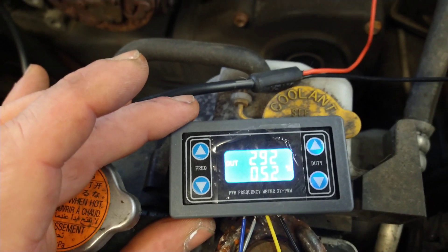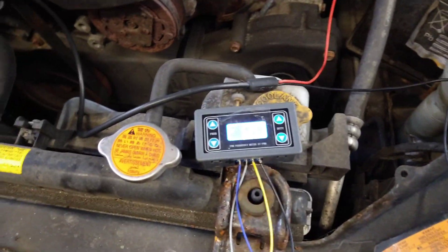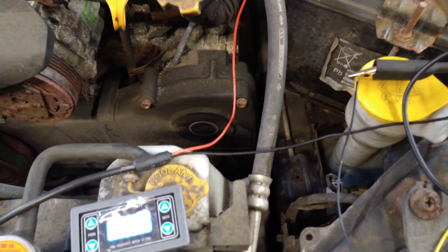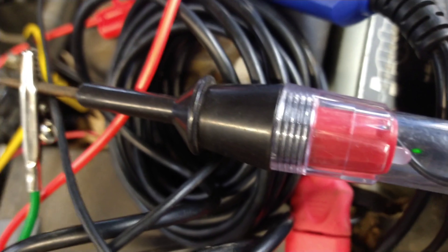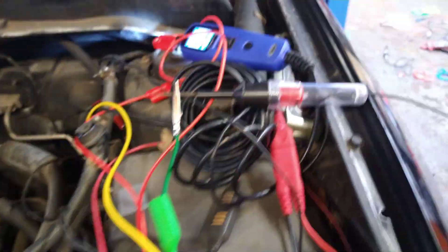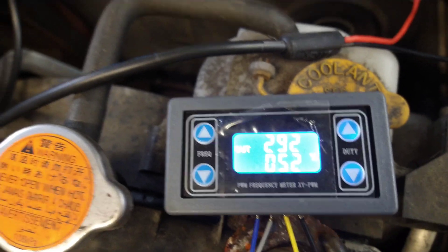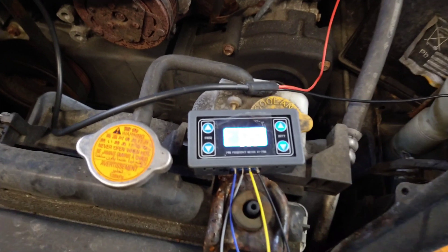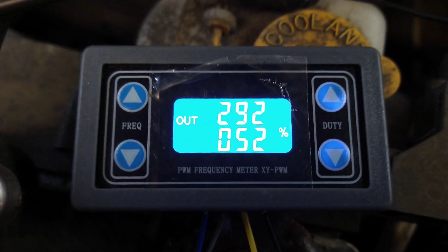Just to be safe, one of the output leads — out of the two leads coming from the battery at twelve volts — I put through an LED test light in series, just to help limit the current. That brings it down to about ten milliamps on that LED test light, which just makes it safe. So it's another way of testing the digital ABS sensor using this as a sensor simulator.